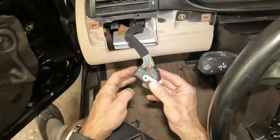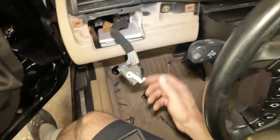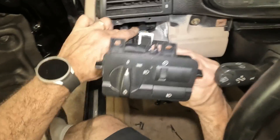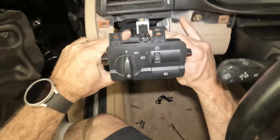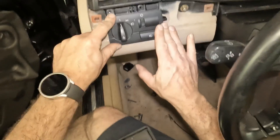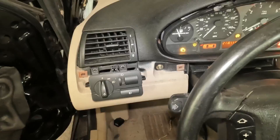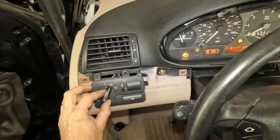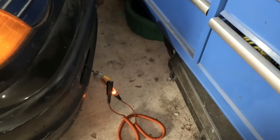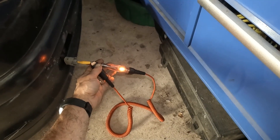Let's put this pin back in and rebuild this connector — it goes brown and blue. Slide them in. My connector is now corrected. It's basically like I fixed my wire or ran a new wire. I'm going to plug my module in and push it into place. With the relay back in, we've now corrected the failure. Go ahead and turn the lights on and press the fog light button — and you can see I now have a working circuit.